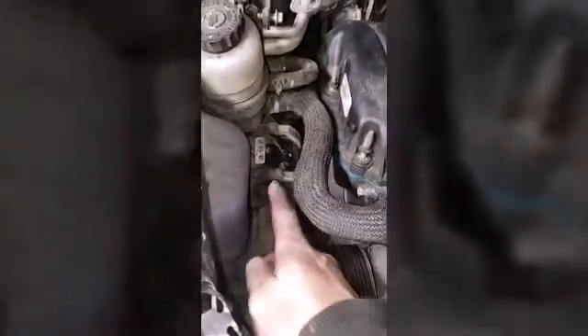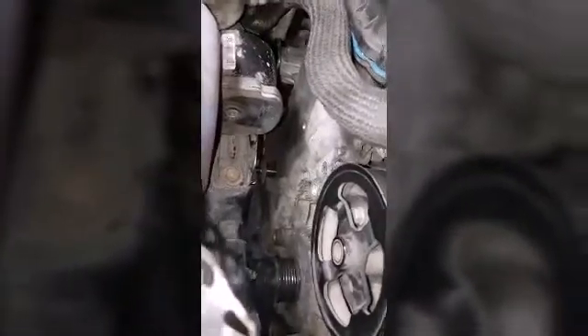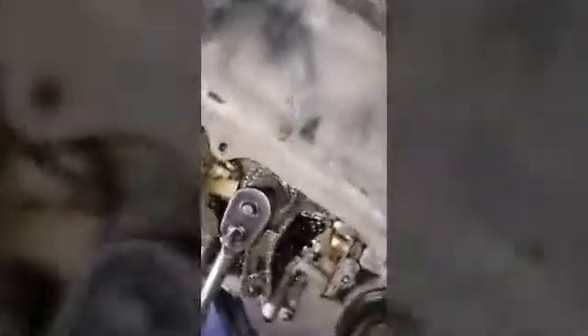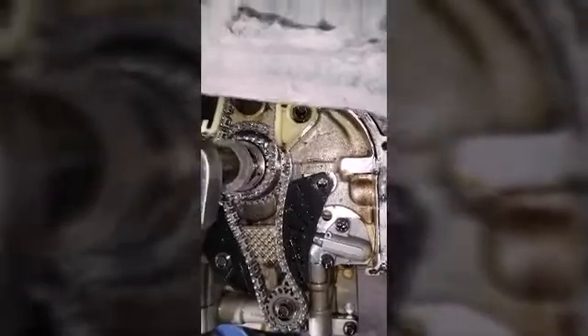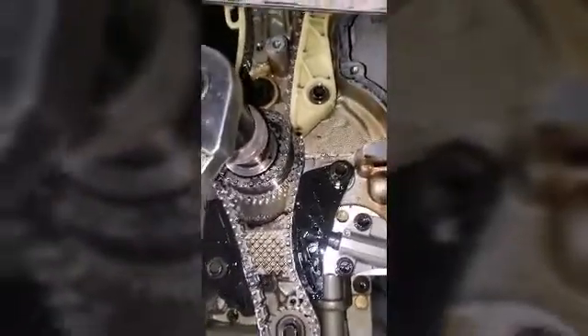I've removed the bolt that goes across your engine mount and the three for the bracket. You're going to remove the bracket, but before you do that you're going to want to support your motor with a jack and a piece of wood so it doesn't fall. Now the full bracket's removed. I placed all the bolts back in because there are two different styles - these two are different lengths than these two, so just put them back where they need to go. Now the timing cover's fully off - it's got a bunch of 12s and 10mm bolts going all the way around it. The next thing you want to do is line up these two marks on your cams before you start taking any of your chains or any of that stuff off. Down below you're going to have your indicator and your crank sprocket sitting around, I'd say about 3:30 or just past 3 o'clock.